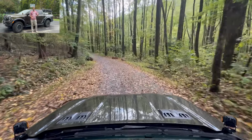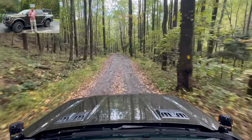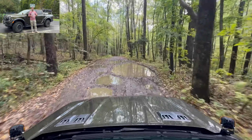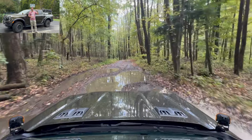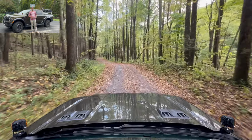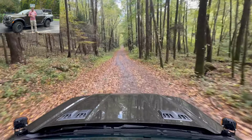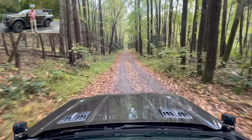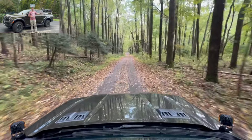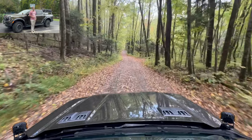And also, it's 80 degrees out, it's humid, so the density altitude for all the runs with the Tune is on average 1,400 feet positive density altitude. So about a 2,400 foot density altitude difference between the stock runs and the runs with the Tune. With the Tune, I did a 5.8, a 5.6, a 5.4, a 5.6, and a 5.8. Those numbers don't seem impressive when you compare them to the 5.8 I did before, but then you take into account that it's 2,400 feet of density altitude higher, and 540 pounds worth of crap.